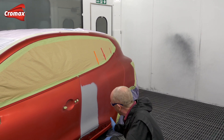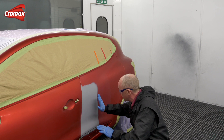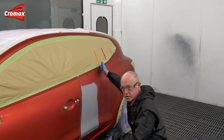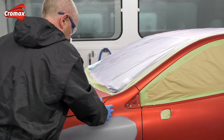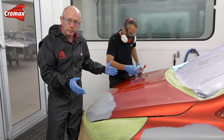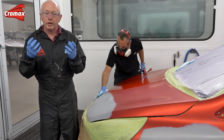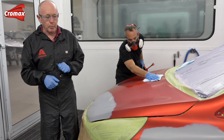So having sprayed the blender, base coat application starts here over the repair, connecting the base coat and the blender together to give me that nice uniform substrate and no openness or coarse structure which will show through in the clear later. I will then finish with a light effect coat coming out as far as the orange arrow, before moving down this car in one and a half coats, applying my base coat as I go, finally coming round onto the bonnet itself, where it's a normal application but to the whole panel. Don't be too surprised if you see a slight colour difference where you've made the blend on the side - the base coat itself is not the colour as such in this case, it is part of the colour build up and tinted clear is there to help you get to the final position.